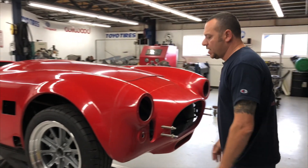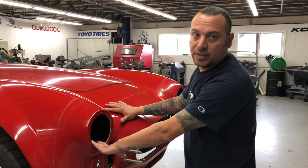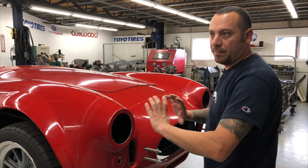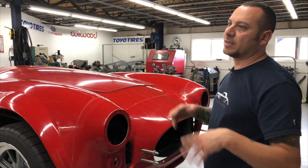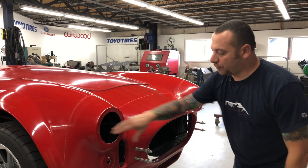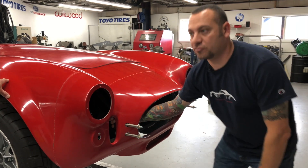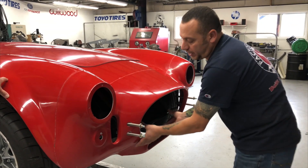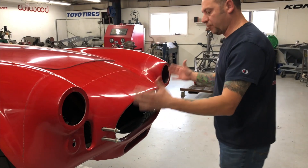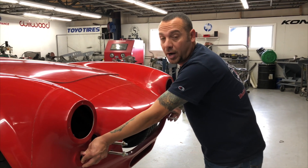As we go to the front, your headlights are trimmed — they're cutouts. All the cutouts that you get from us when you do the actual cutout option are going to be undersized. That'll have to be opened up per the bucket. We undersize everything because you can obviously take material off, but you can't put material on. Your front body mounts are your lights, which are a super nice, super easy construction the way they're made. The body mounts, when you set your body to the front, you always want these centered. With these bars centered, your marker light actually holds the body on.